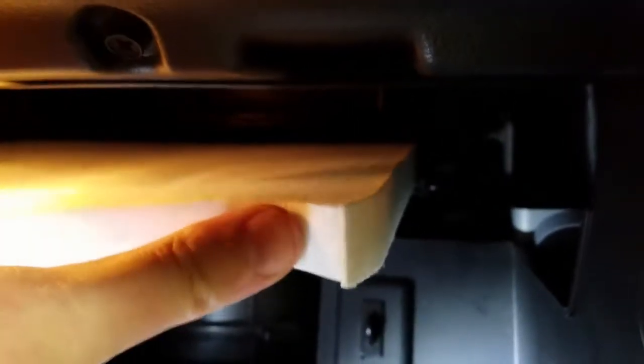I've got a new one right here ready to go. You want to pay attention to the arrow — the airflow is going to be going down, so you want the arrow to point down. That's the little gap you're aiming for. If you get it right on both sides, it just slides back in there.